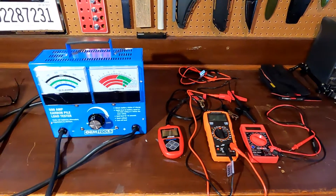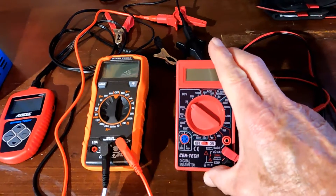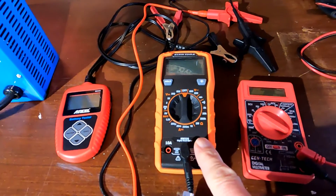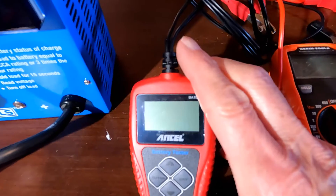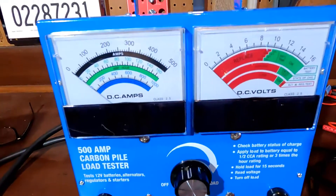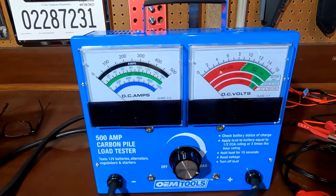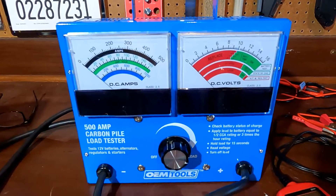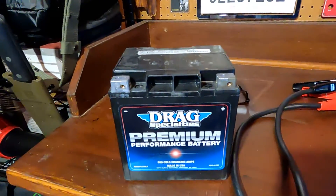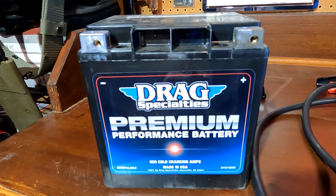I just based it on experience and performance, but there are ways you can actually test your battery, and I'm going to show you the three ways. Here's the equipment: starting with a very cheap run-of-the-mill multimeter, or a step-up Klein multimeter of better quality, a digital battery tester, and finally a carbon pile load tester — sometimes referred to as a toaster. These are real old-school but really the only true way to put a load on your battery short of using your actual starter. The battery we're testing today is the one I took out of my Road Glide, which was still working but starting to go.